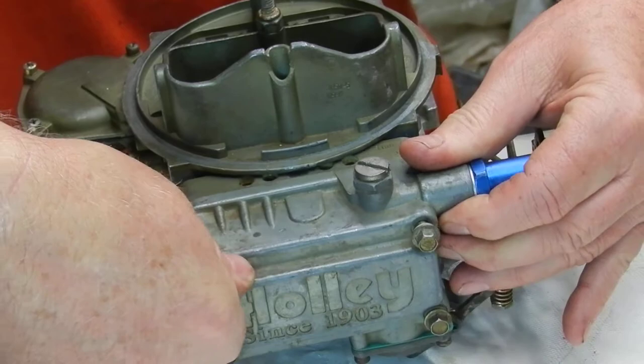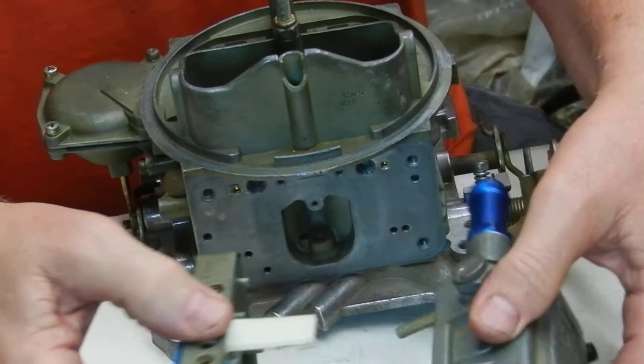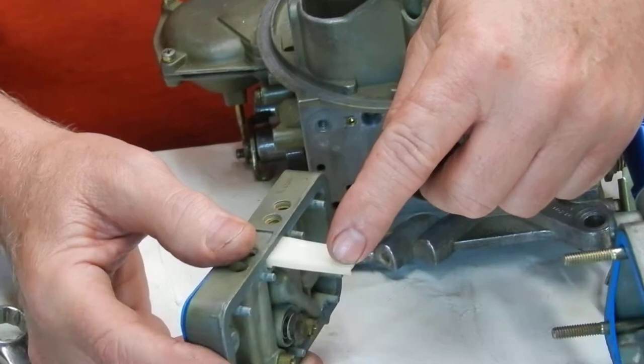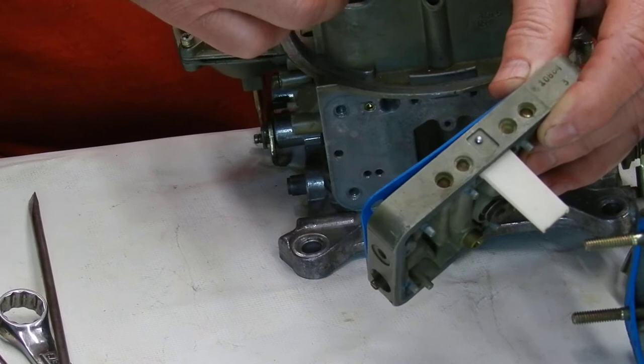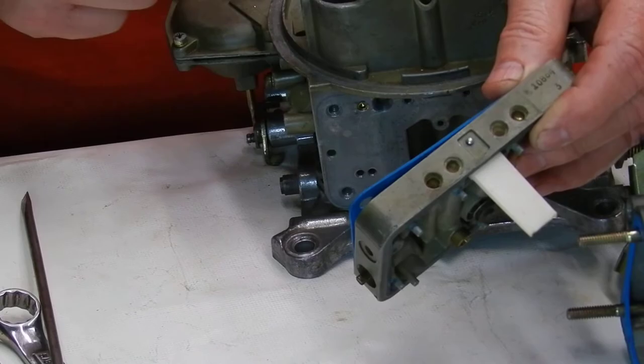Let me show you something real here. I've got these just about all the way off. This is the actual vent hole to the atmosphere — this is the actual vent in the carburetor. What it does: if this wasn't in there, basically the fuel would be coming right through, and when it got in a hole and rocked hard, it'll come right up over this vent tube here.